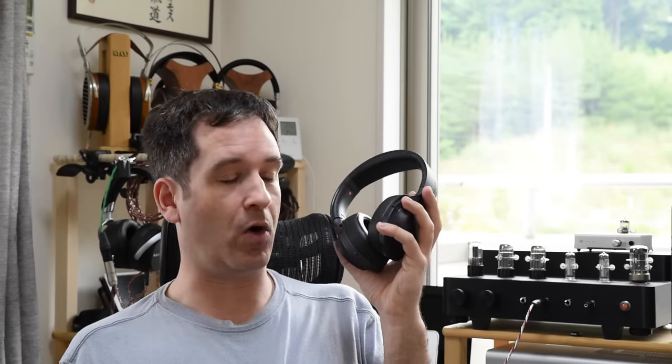That brings me to the third method — what happens if the battery does run out? They can still be used as passive headphones using the input. The problem is that while they are 32 ohms and about 103 decibels sensitivity with the circuitry activated, they are only 16 ohms and 98 decibels sensitivity with the power off. When I tried listening passively, the sound quality disappeared — the highs disappeared, the bass was booming and awful. Generally not a good experience, and I would totally not recommend it. If you're thinking of using them passively, I would recommend other headphones.